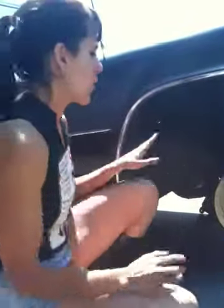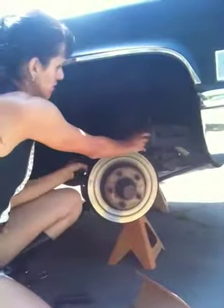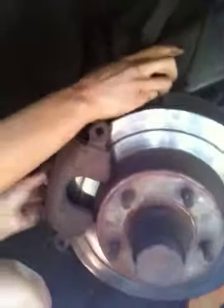I'm going to throw a couple of other little tips for old car enthusiasts. When you first get an old car and you're inspecting different things, I highly recommend you inspect the rubber brake line. This is going from the hydraulic system — from the master cylinder — all the way to the caliper. It's very important that you inspect it for cracks, because if you don't, you'll start dripping brake fluid and lose your brakes. That happened to me once and it was very scary. With older cars, you don't know what has had attention and what has not.